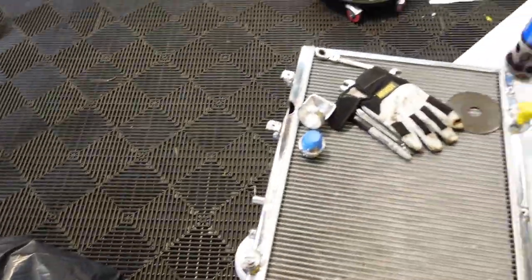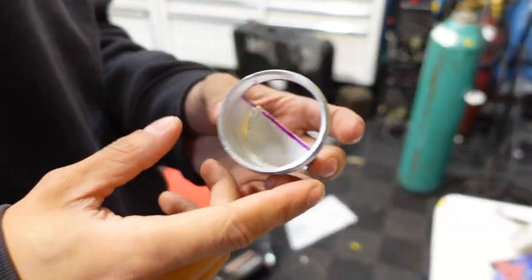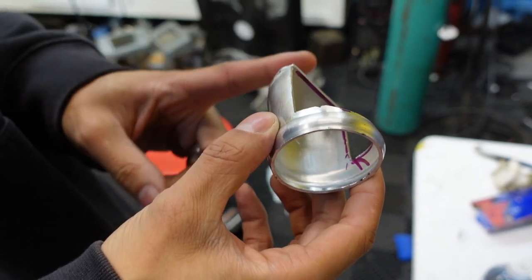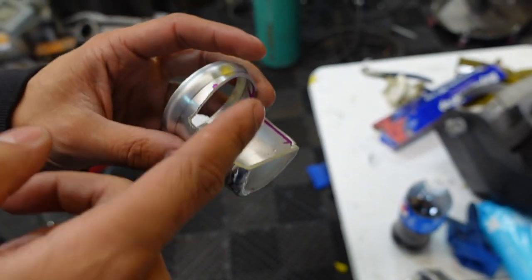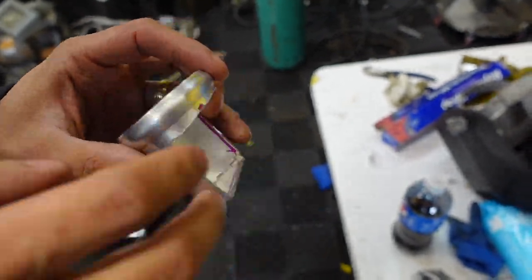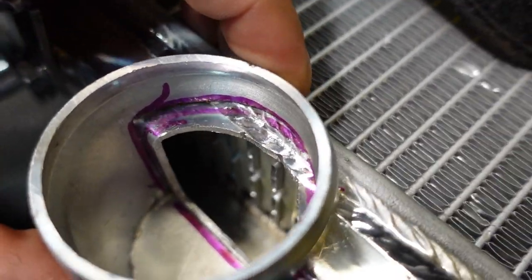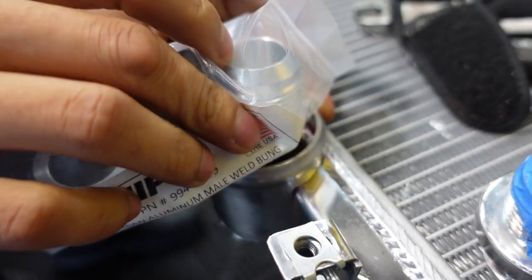Talk about it, Joel. What'd you rig up here for us, pal? So, I think this is two-inch or inch-and-a-half pipe that we cut about 2.5 inches off of. Cut a little back plate. Shaved some of the top off so it could go over it. And that's how it's gonna sit on the bung. It's gonna sit right in there. I'm gonna weld it shut.